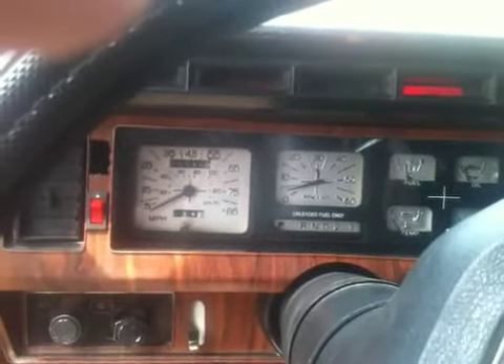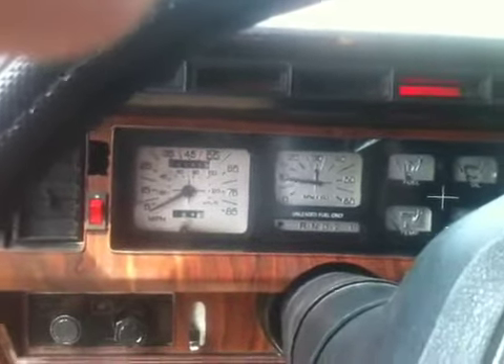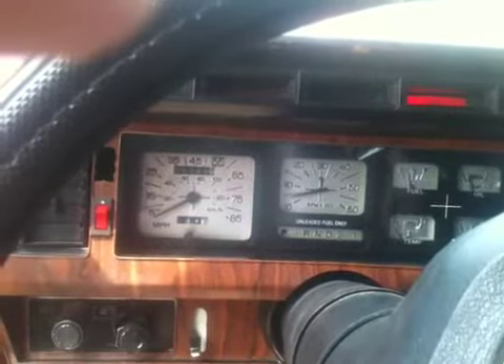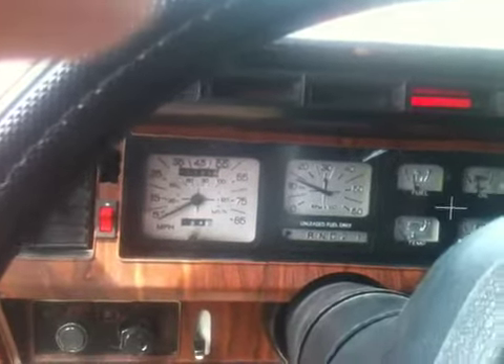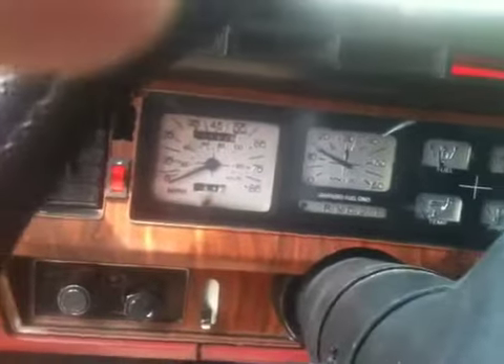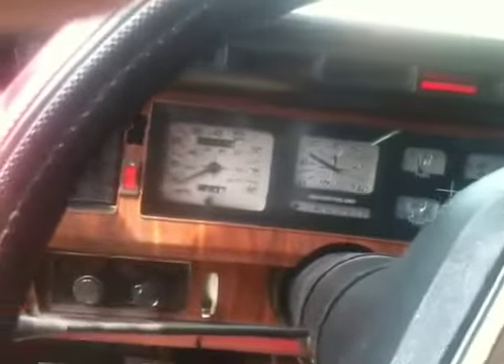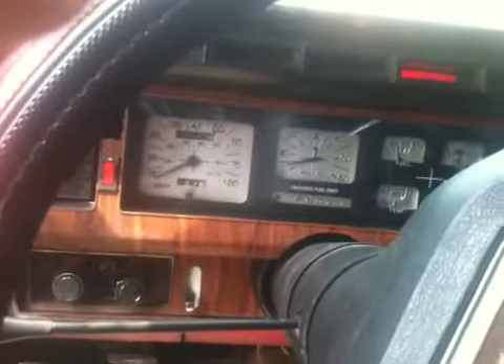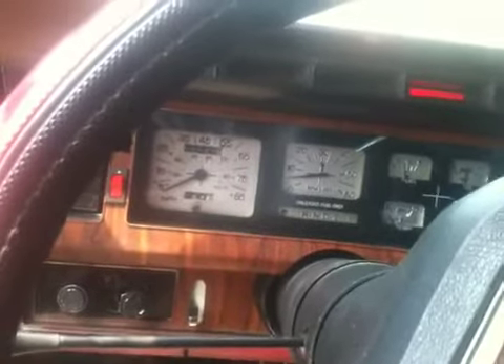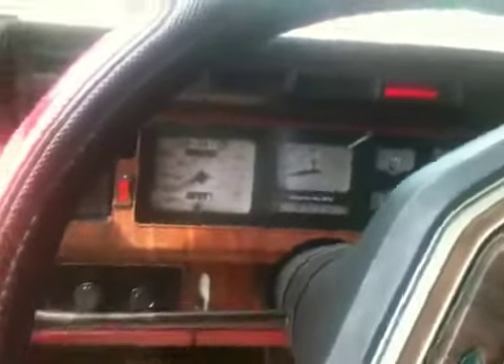Of course, this was a warm start — it's about 80 degrees out here. The carburetor loads up a little bit, that's why it doesn't idle quite smoothly on startup. It smooths out, though, as it gets running for a minute.